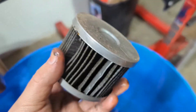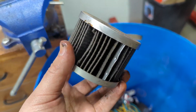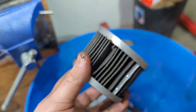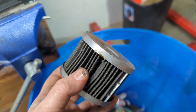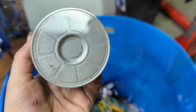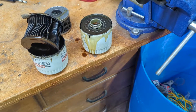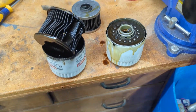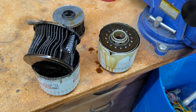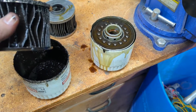This engine in this boat — this is from my actual boat engine that blew up. I knew that it was expiring before it expired, and this was one of the things I did to check just what the life was or what was going on with this boat engine. So that's something you can do if you heard a weird sound or something doesn't feel quite right — just pull the oil filter out and cut it open. It's a quick, cheap deal.